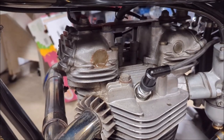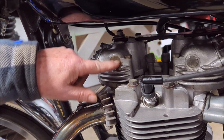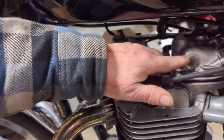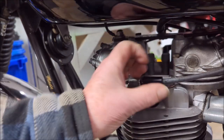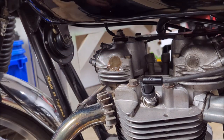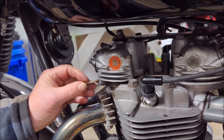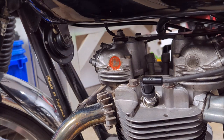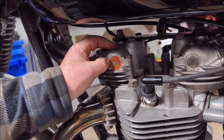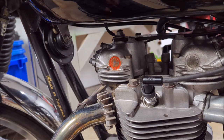So obviously this is our issue here — part of our issue. Somebody's tried to seal it; obviously there was a leak here. It's not uncommon for these things to leak. There's an O-ring in there and if that O-ring gets brittle, which it often does over time, then it will leak. Rather than fixing the problem, somebody put something here to try to get rid of the leak. I'm just using a pick to try to pull this crap out. I'll probably fast-forward through some of this. I think that's actually silicone — so I guess before they put the JB Weld on it, they put silicone on it. That's a bit of a nightmare.